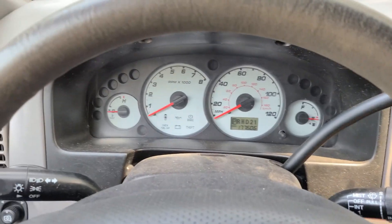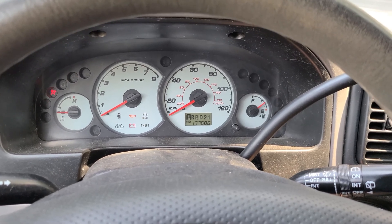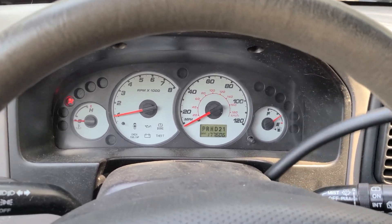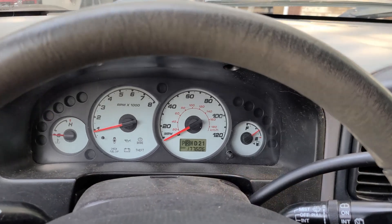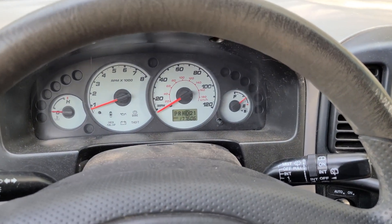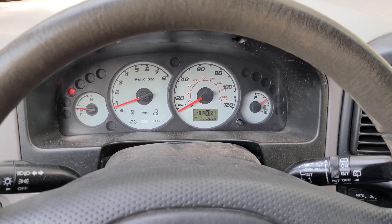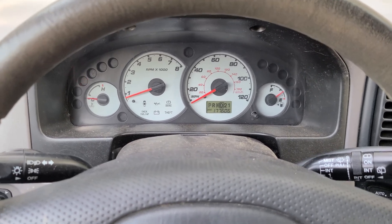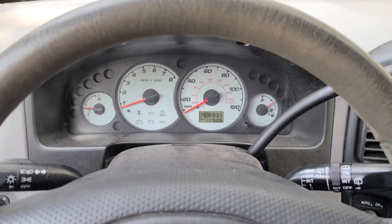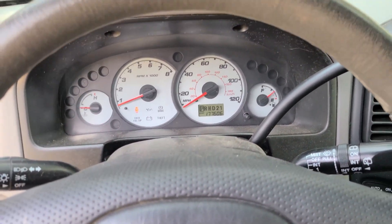Before, it would not go into reverse at all. I'd put the selector there and I could rev the engine up and it just wouldn't go in. E-brake is off — let's see. Yep, I can already tell it is in gear. I've got a sloped driveway. Put it in drive — nice. Before when I put it in drive, it was like I was starting out in second gear; it just did not want to move up a grade at all. We'll go back to reverse — yep, now I can feel it. Cool, that fixes this thing. If you have any questions about the transmission range sensor on your Ford Escape, put them in the comments. Thanks for watching.